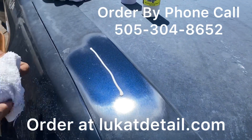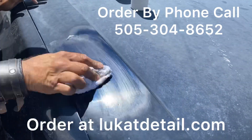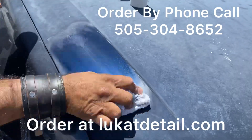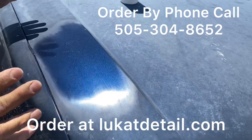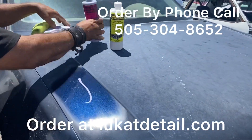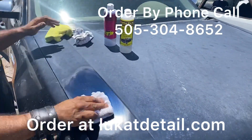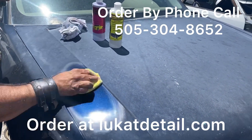Don't mix the towels up. Make sure you use a terry cloth towel for the cleaner specifically, and then use a separate one for the wax, because the cleaner is designed to break down old waxes. Sometimes people think it's a lot of work, but it's up to you. You can do the quarter panel here, do half the hood panel, and come back next week or even six months later. The reason is you're not masking a problem like with wax — you're fixing the paint job by cleaning it.